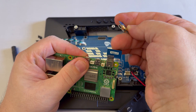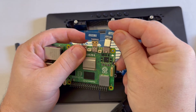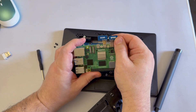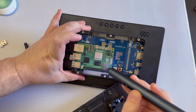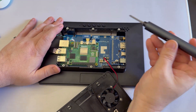Mounting my Raspberry Pi 5 into the monitor is pretty straightforward in principle. You attach the included HDMI and USB-C adapters to the Pi, line them up with the pins on the monitor's internal board, connect the fan and USB touch cable, secure the Pi with the included screws, and then attach the plastic bracket and the back of the monitor.